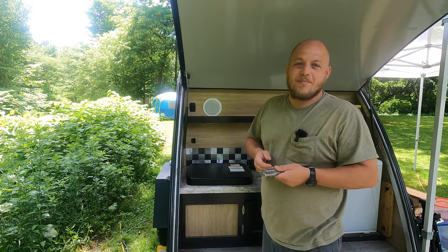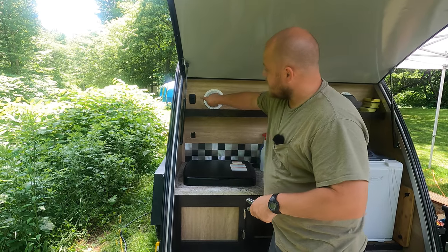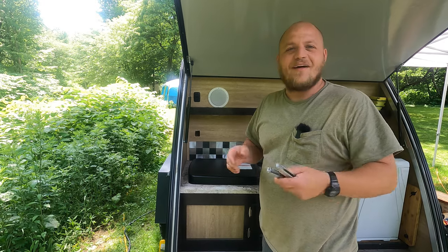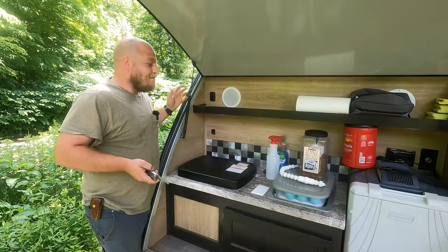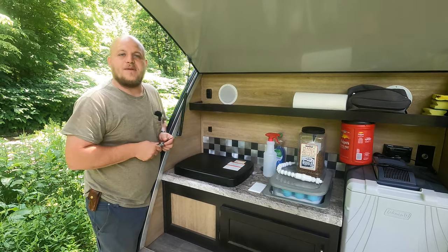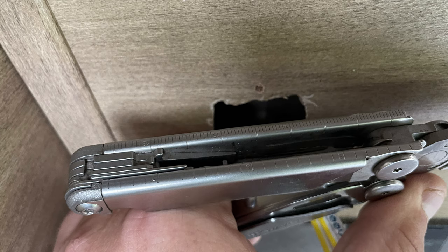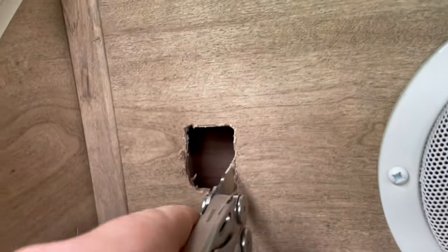Because I was out here on a one-week camping trip, I didn't have any real tools with me. So I took my Leatherman and began with the knife to just etch back and forth on the wall. In about 45 seconds, I put a decent-sized drill hole in the wall — obviously a power drill would work better, but it does demonstrate how easy this project is. I then used the saw on my Leatherman to cut a small rectangular hole for the new placement of the switch. First I checked to see if there was an open pathway to run the wires to a higher position. Once I realized there was, I measured the original cutout for the switch with my Leatherman and traced it out above where I wanted the switch to be.